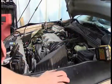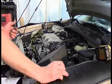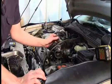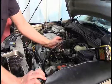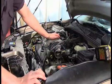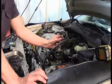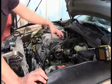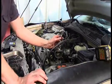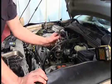It tells the temperature of the air, and the engine uses that information for some stuff I'll explain after the video. Oh, and by the way, on some car models, this guy is not in the air snorkel. He's located on the intake manifold somewhere, or on the plenum. That's kind of an unusual location because of the heat soak, the higher temperature. But of course, the software in the PCM is designed to calculate for the higher temperature.